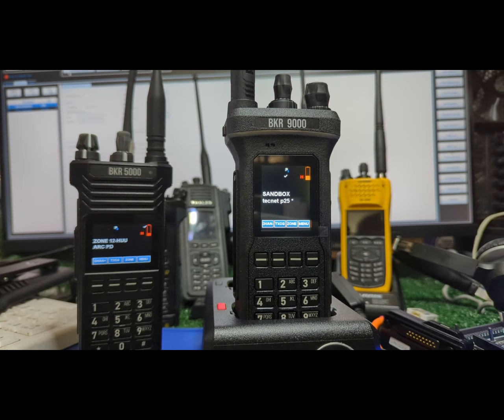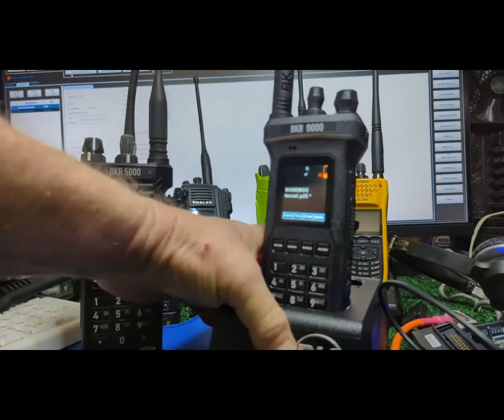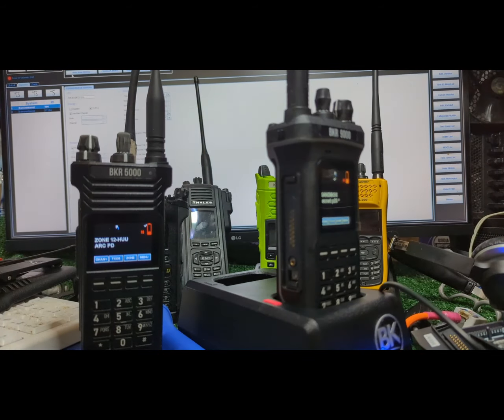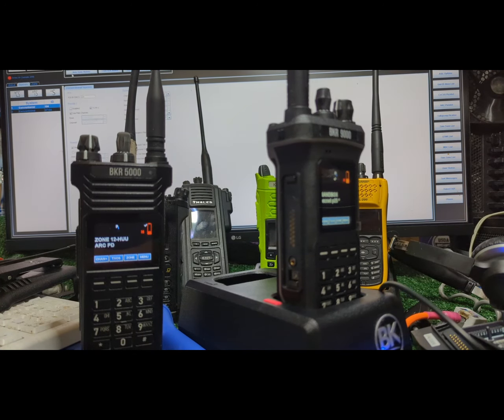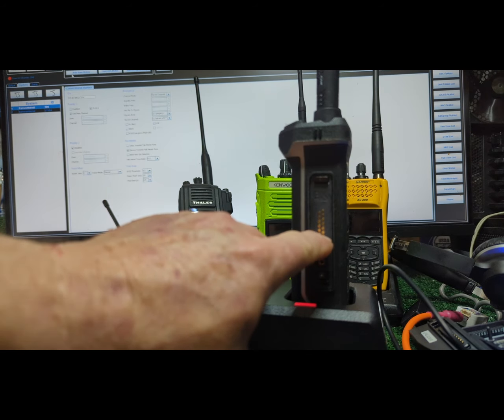I'm gonna turn the GPIO on as well. The reason being: you've got all this voltage on the side connector. If you drop steel wool on it — or on the other side — there's B+ on at least one of those pins. Imagine if you dropped steel wool on there, it could pop a fuse and put you out of service. I haven't licked it yet to see if I taste any voltage, but I bet on the GPIO pin there's going to be three volts or so to sense when it grounds pin 11. You count down six on the bigger row and that would be your GPIO.